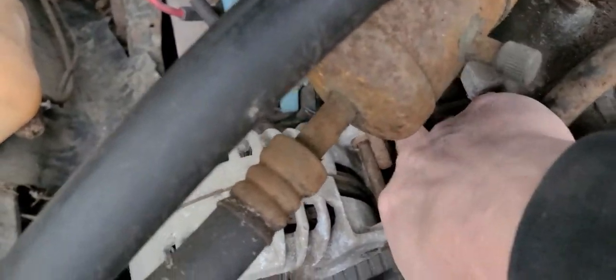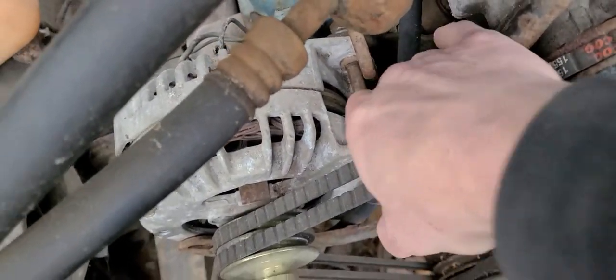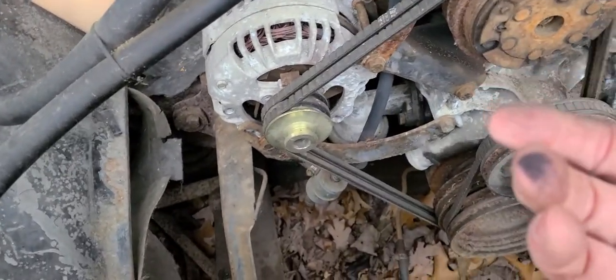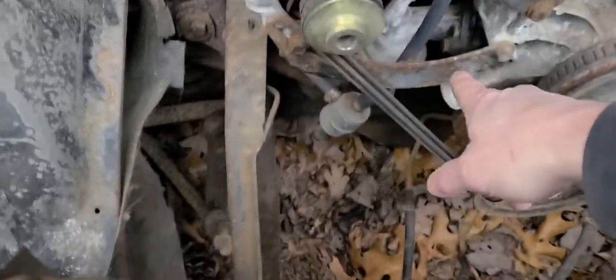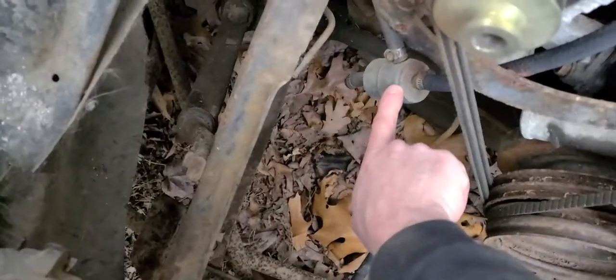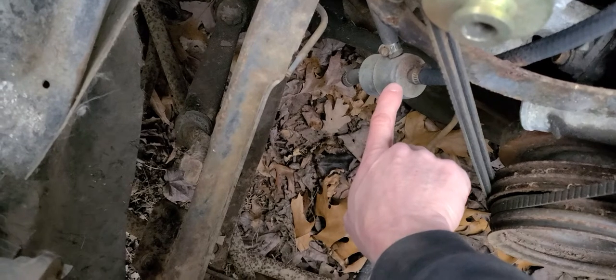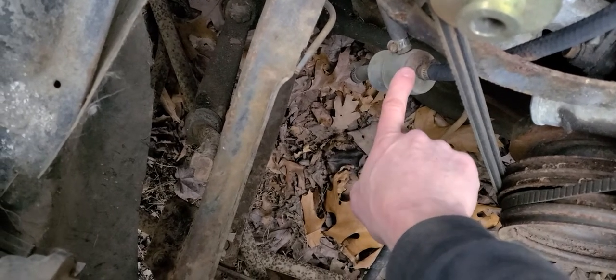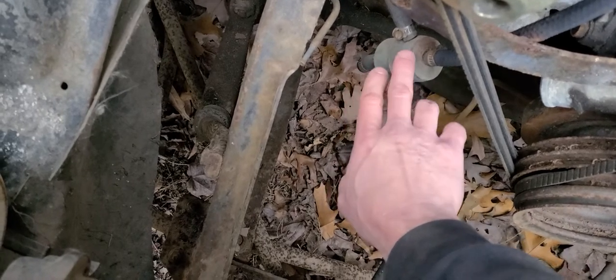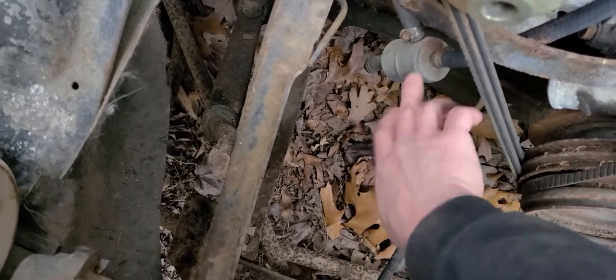I'm going to be replacing this really, really ancient hose — I just rubbed my finger on it and part of it is actually coming off on my finger. When rubber gets really old, that's what happens. I'm going to replace that. It runs down through here, and I'm probably also going to replace this fuel filter. I'm going to put a clear one in place of it right now, and then later I'll be going with something a little more correct, a little bit more like this.